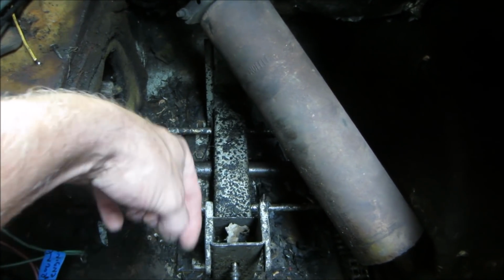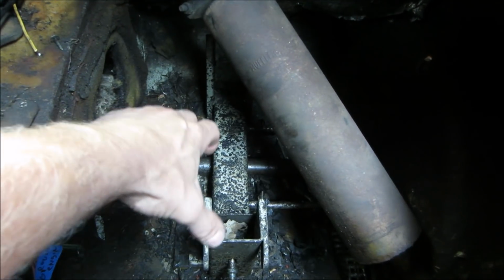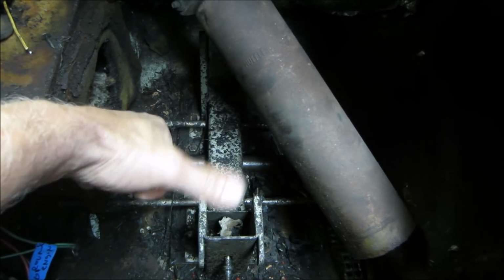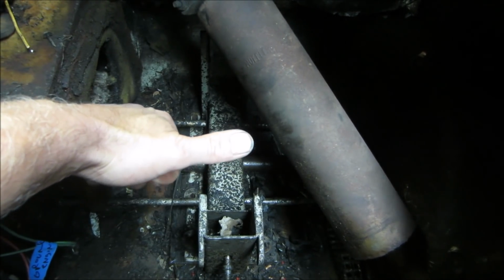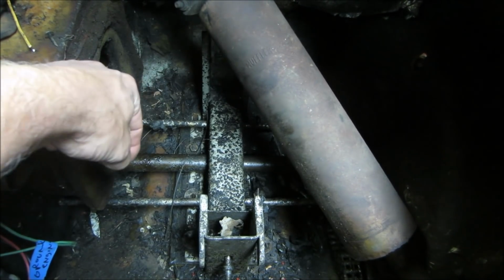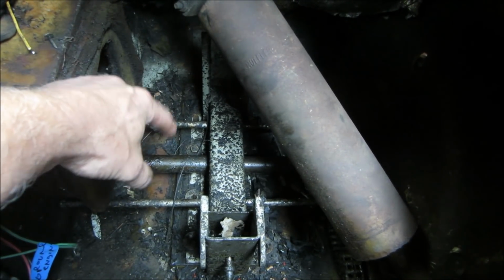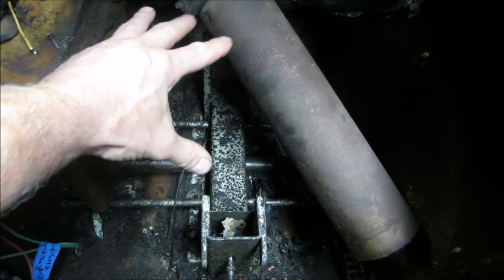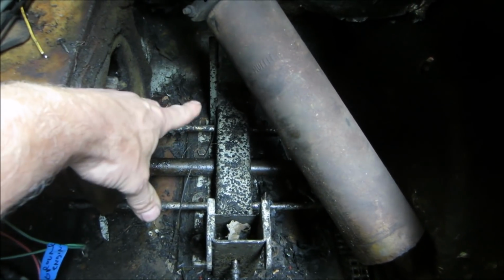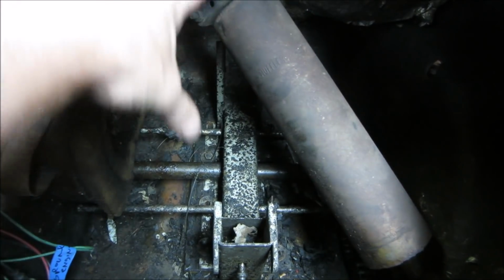Normally that would have a sprocket going out to whatever you're going to drive. But instead, you put a gearbox on the end of that, and that gearbox has a forward and reverse lever, and I think a neutral in the middle of it. So it gives you a transmission through the CVT, so you'll have full speeds forward as pretty much as you do backwards, which is kind of needed in this for when it's in the water, and the tires need to have some momentum going backwards to do anything. So that's what I'm thinking for the drivetrain.